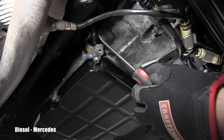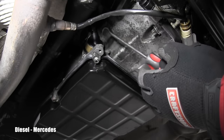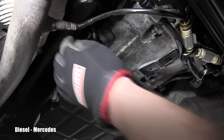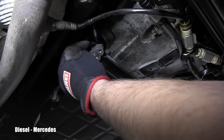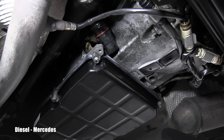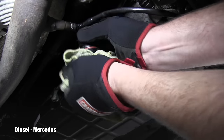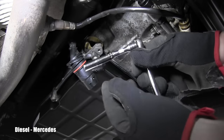I'm going to continue this service with replacing the electrical connector. The first step is to release that beige ring — there is a tip on top which I need to turn counterclockwise. Using this hook, I can see it going down all the way, and I can remove that electrical connector. We are definitely right to do that because look how shiny it is — there is definitely an oil leak there, so this replacement is absolutely needed.